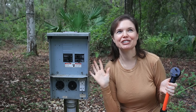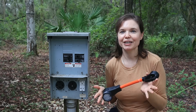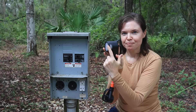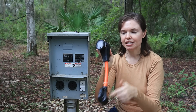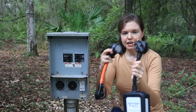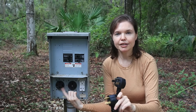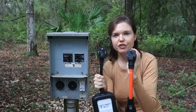It would totally be a bummer to get all the way out into the middle of nowhere and then realize you don't have the right adapter. This is the one I chose — I'll link it down below. It's not sponsored but it works and I love it. This one has a light on the side so you can visually confirm that this part is getting electricity and working before you plug it into your vehicle. I'm going to leave the 50 amp connector plugged into my mobile charging unit — this 50 amp plugs into one side of the adapter, and then the 30 amp side of the adapter plugs into the middle 30 amp outlet. Notice the 50 amp has four prongs and the 30 amp has three, so you really can't mix these up.